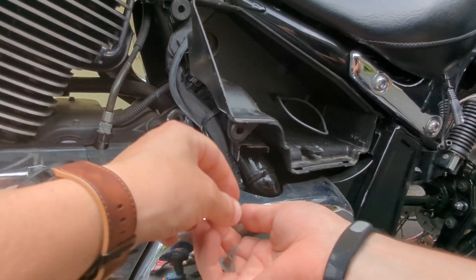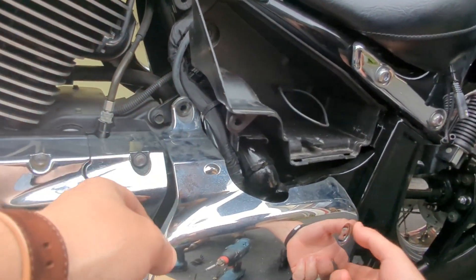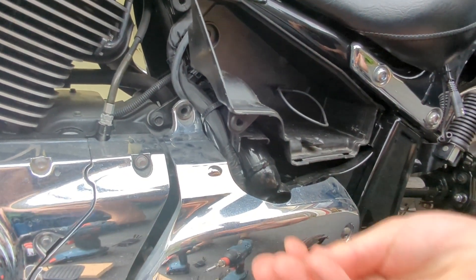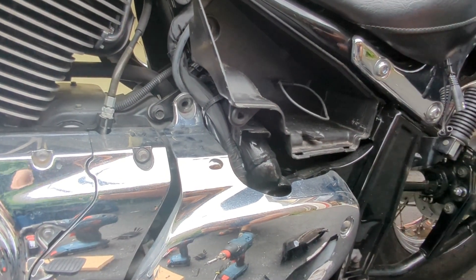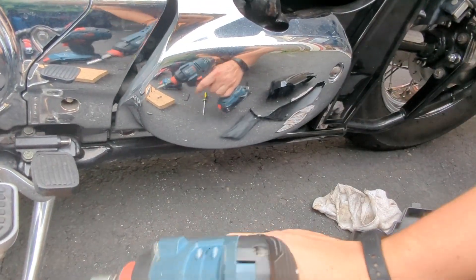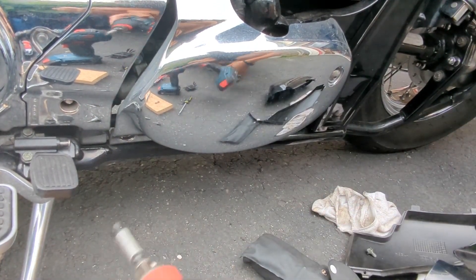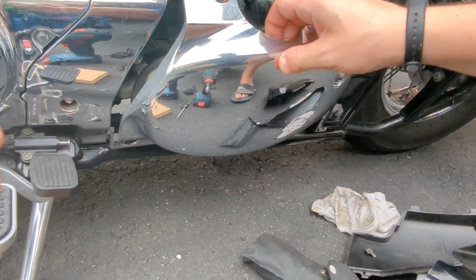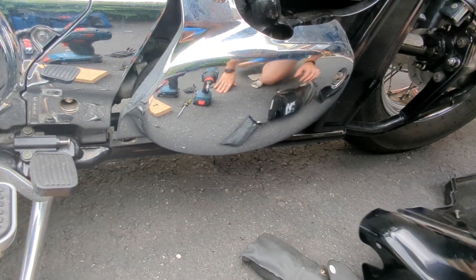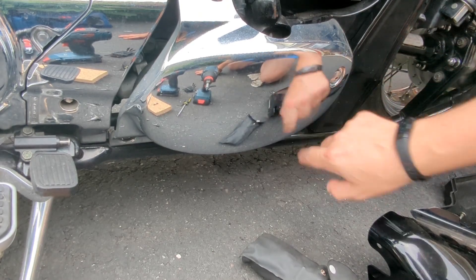You've got to take this bolt out. This is an Allen key but you can use a star bit — usually that'll work. Take this cover off. There's another one down here, so there's one bolt and another bolt right below here, same type. I'm going to remove both. And there's a third one as well. This is a fake one right here, and below it there's a real one, so you want to remove that one as well.